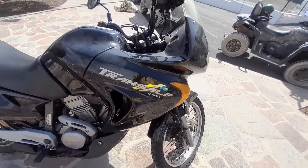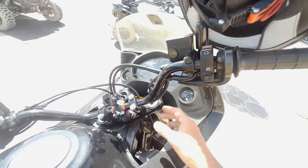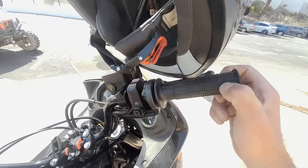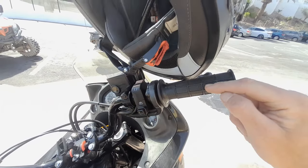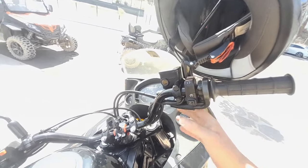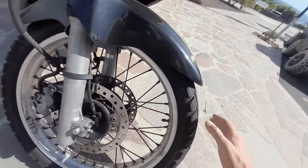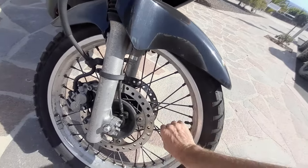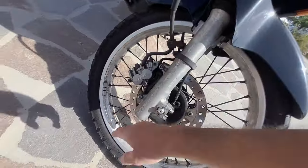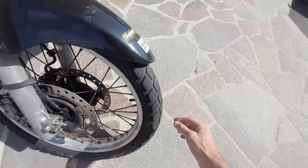I'm going to change the handlebars because they're terrible — the rise is okay but the internal bar weights are rubbish. This bike also suffers from uneven tyre wear, which quite a few owners have reported. It could be down to the spoked wheels not being kept in true or being unbalanced. These tyres are a little old but still have good tread left.